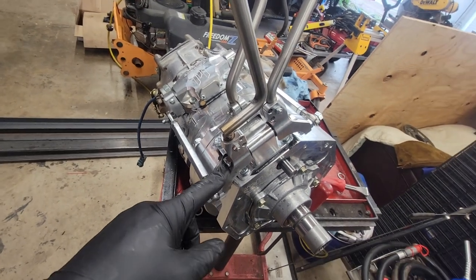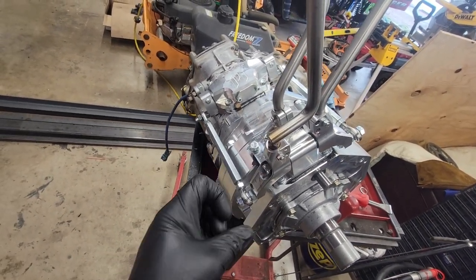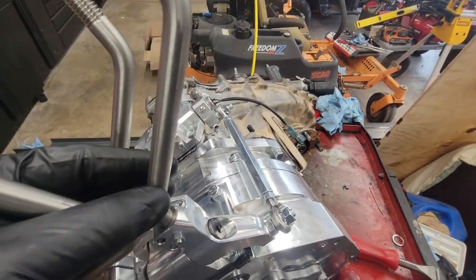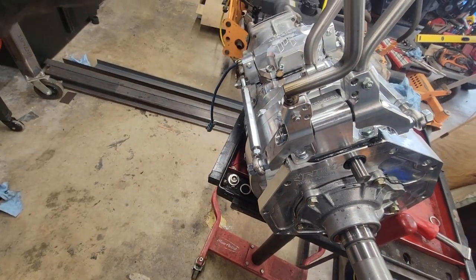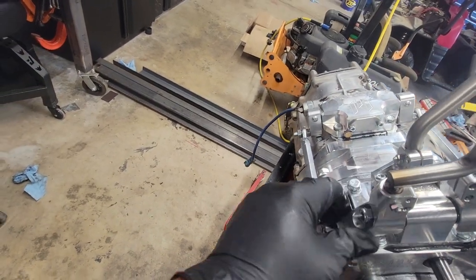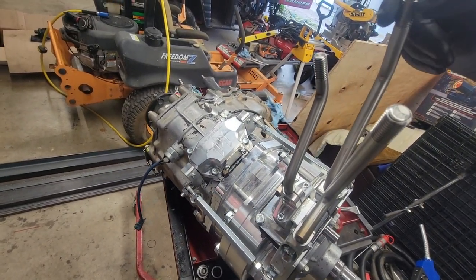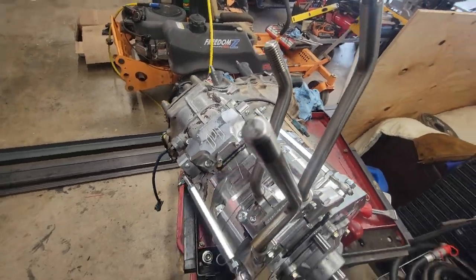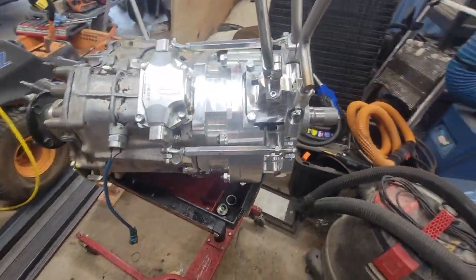This bolt is snug. It is a nylon lock washer. I'm gonna put a little paint pen on it and we're gonna watch it. I'll probably end up red Loctiting it. There's quite a bit of slop in these levers. This is definitely not how it was. Well, you can't judge on that. Not how Toyota was. I mean, you guys know Toyota's tight tolerances. This is pretty sloppy, and we'll see. Whatever, it's going on 40s, so I don't really give a shit.